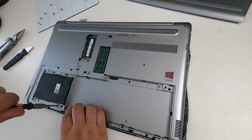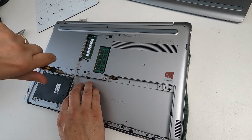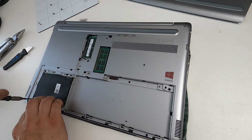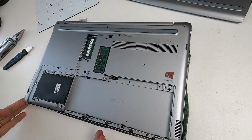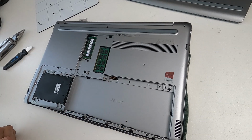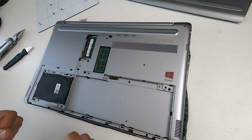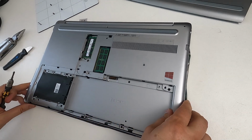So remember, using an electric screwdriver, I think, is okay for undoing screws, but I wouldn't use one to do them up because I'm just a bit worried that I'll lose concentration and destroy something. Because the outer shell is plastic, these screws sit in a little brass fitting that's got teeth on it. They push that into the shell, into a little sort of cylinder, and it grabs and grips it. And if you over tighten screws, you can cause that to shatter the plastic around it. So you've got to be a little bit careful how you do things, I think, anyway.